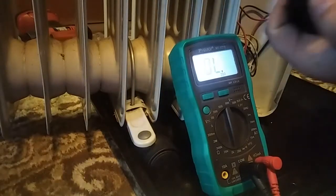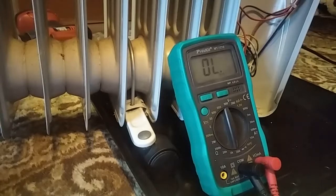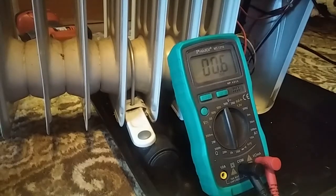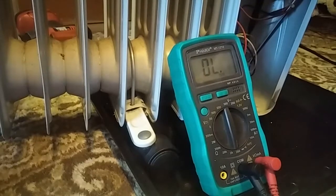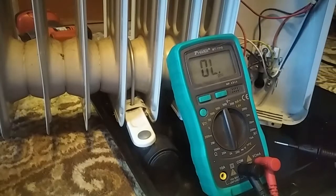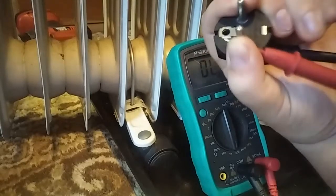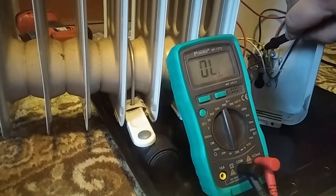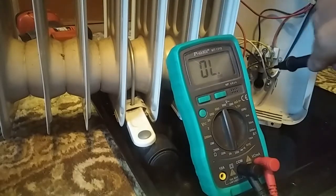And then it struck me. If you connect one probe here and take the other probe and touch the terminals, you get 0.6 ohms — that's the resistance of the wire in the cable. On the second terminal you get 60 ohms — that's the second heating element running in series with all of that. So the left lead on the power cable is okay. But if you try the same with the right one — looking from the side you'd plug into a socket — you get infinity, and again infinity. That basically means this lead is not connected to the heater at all.